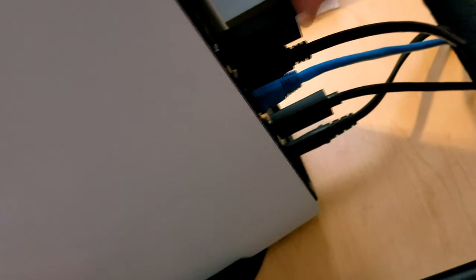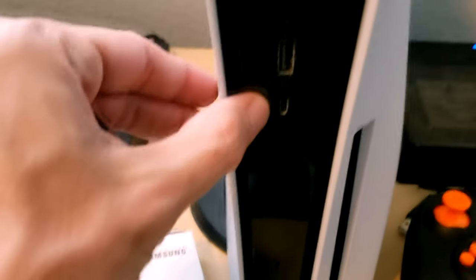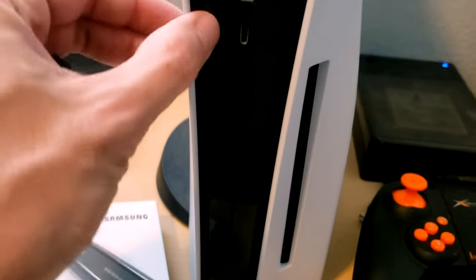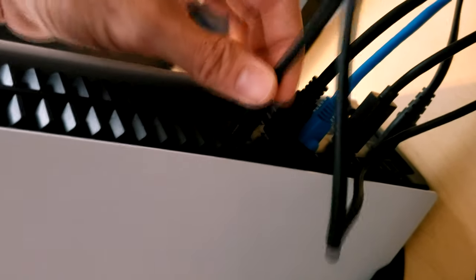To install that, it's very easy. You've got these USB ports in the back. One is taken up by a Bluetooth dongle for my official PS5 wireless headset. But there are two USB SuperSpeed ports — you can see that they are blue, which is the correct color coding, and they also have the SS logo for SuperSpeed. There are also ports on the front. This USB 3 port is rated as SuperSpeed. The other front USB port is for connecting controllers and charging. If you buy an external enclosure that connects via USB-C, these are USB-A, so you could plug it in the front. But for aesthetic reasons, you're probably just going to want to plug it right in the back. Easy peasy.